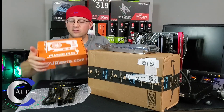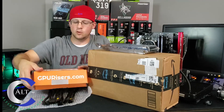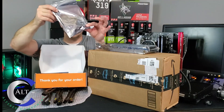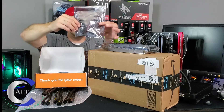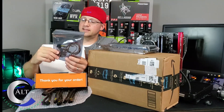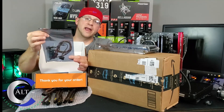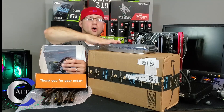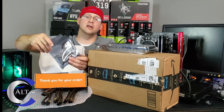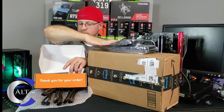What's in the beautiful orange box? This is a GPU Risers.com box. That is a pico adapter for our server PSU. What a pico adapter does is let you plug it directly into your motherboard — without a pico adapter, a server power supply cannot plug into the motherboard. You either need a pico adapter or a ZSX all-in-one breakout board to use any server PSU with your motherboard. That's a nice little addition.